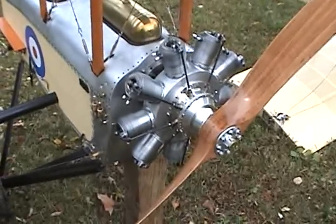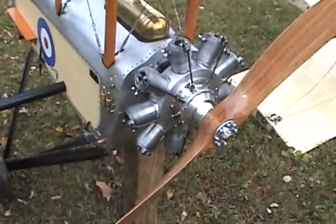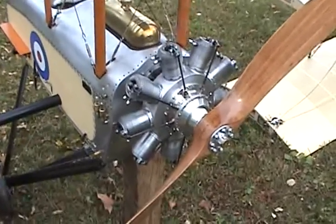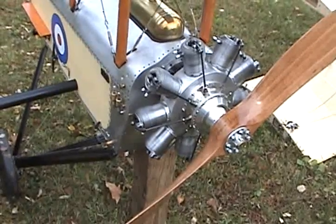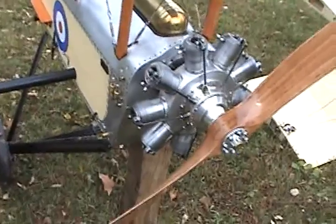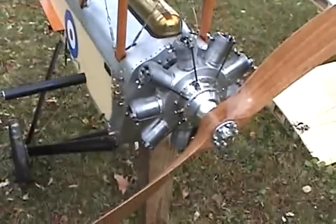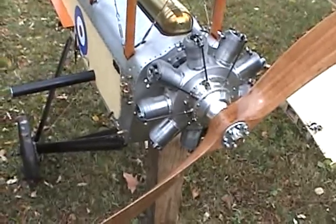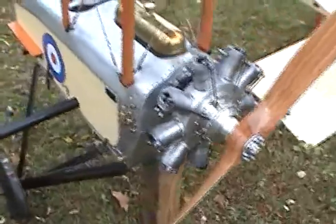The spark to the cylinder comes from the magneto. At high speed, it took two revolutions to fire all the cylinders. The next speed was four revolutions, then eight, then 16 revolutions. On the third speed, you're talking maybe one firing per revolution. Fourth speed, one firing every two revolutions — which is pretty remarkable.